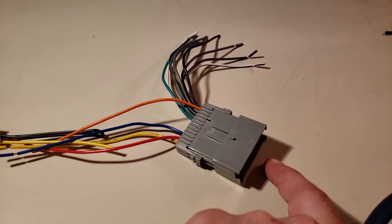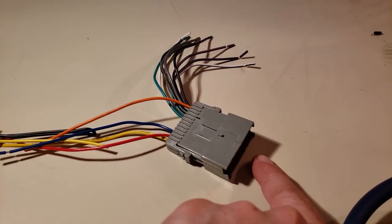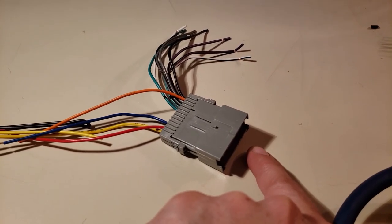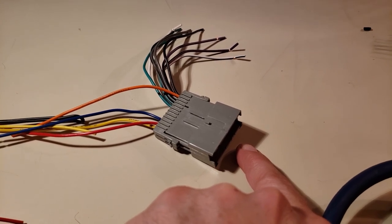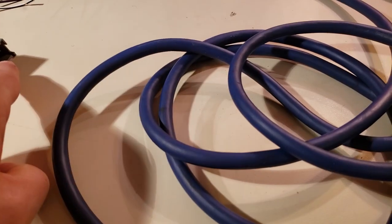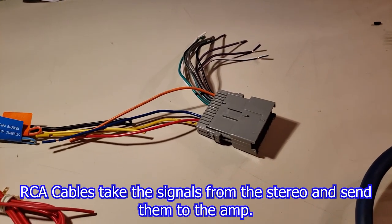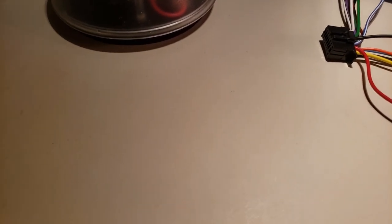The speed wire is going to go to the back of the amplifier on one end, and find its way back up to the wire harness on the other. I'm not going to be connecting the radio speaker outputs to the car's speaker wiring — I'll be connecting the amplifier speaker outputs to the car harness instead. Because the speakers already work with the factory radio, all we're doing is tapping into the existing wiring right there. So I've already got wires going to all four speakers — that's eight wires. The only piece missing is the RCA cables running from the back of the radio directly to the amplifier.